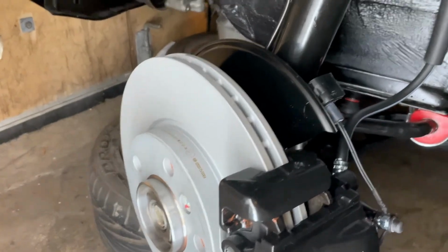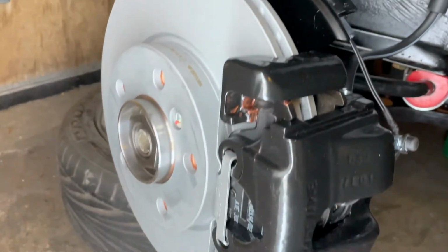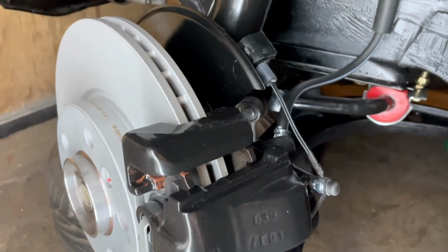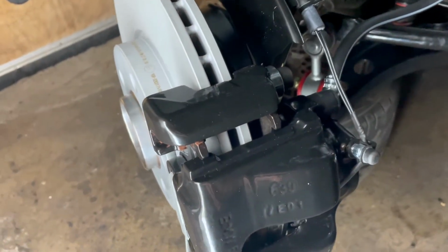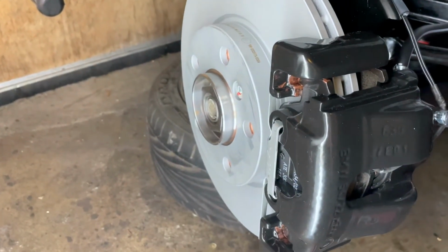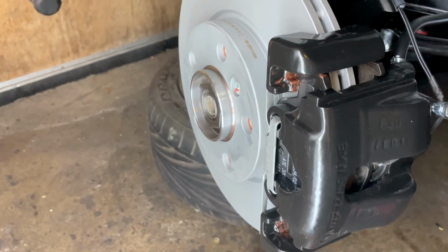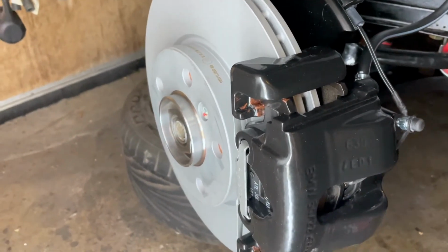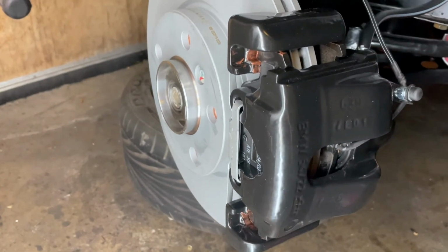So finally, guys, look at this. The brakes are installed. It looks amazing. What can I say? This setup is quite nice. The Eptech adapters for the E46 or E36 calipers, together with the Mini Cooper S, I don't remember the year, 2008, 9, something like that, 294 millimeter front rotor. Yeah, looking really sharp.